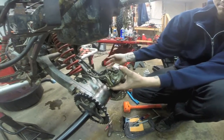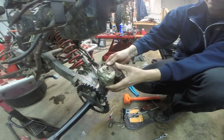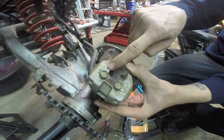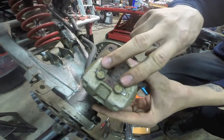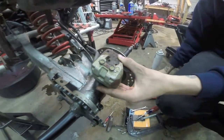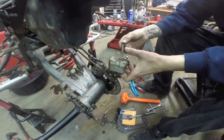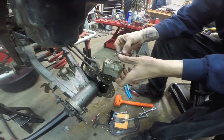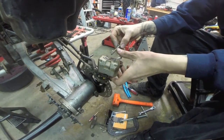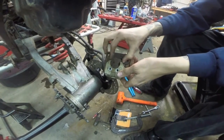Just pop those two bolts out, the clips come off and you gain yourself a little bit more room to work. Before we go any further, you're going to take a screwdriver and bend these four tabs down. These are your pad mounting bolts — they're 12mm. We used a hammer and a screwdriver just to bend them over real quick. Then you're going to take your 12mm and take the bolts out. Once you get them loose, you're just going to pull your pins out. When we reassemble, we're going to take some anti-seize to put on these pins so they're lubricated. Your pads actually slide in and out on these — you want to make sure they're greased up so they don't bind and the pads lock up. Then your pads should just wiggle out.